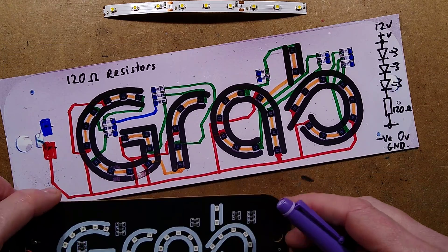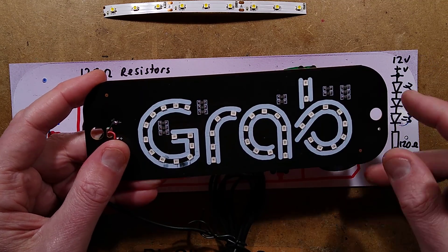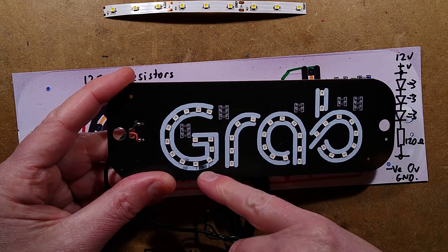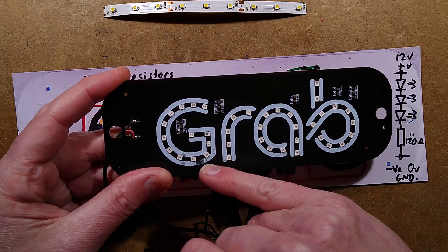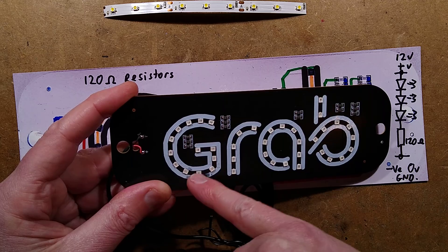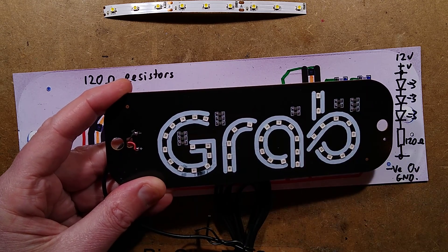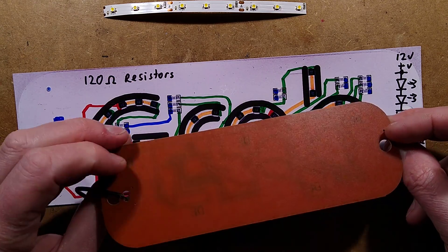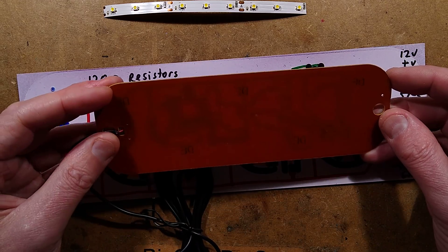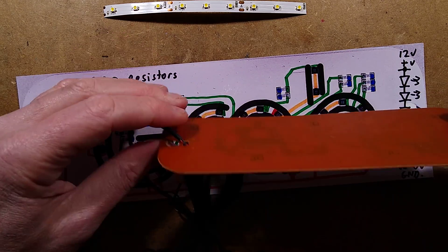It's an interesting idea and it does suggest that if you wanted to make a standard sort of signage thing yourself, you could do the same thing. It's also interesting to note, apart from the slightly crappy screen print here, that you can actually see the segments. The actual outline of this is tracks — they've just laid it out as a circuit board. It's pretty neat. The back of it is just cheap material, that sort of SRBP synthetic resin bonded paper, with two thin wires going through it.